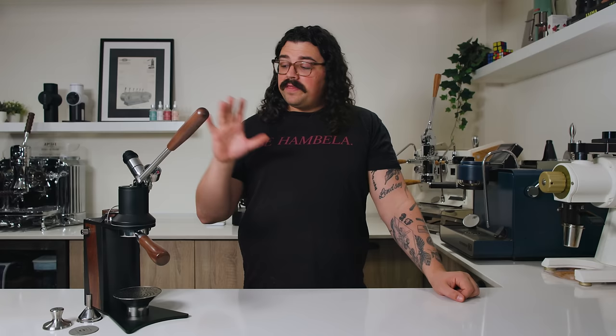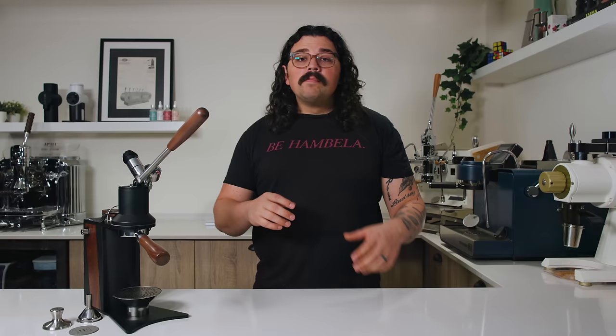And this can happen on both a direct lever or a spring lever. You can have closed boilers on either one. This machine is actually a closed boiler unit. I tend to prefer closed boiler systems. That's not to say I don't love open boilers as well, but when you look at something like the Cremina or a lot of these vintage lever machines that I have and use, I've really come to love that pressurized pre-infusion from the steam, that steam pressure just blasting water over the puck